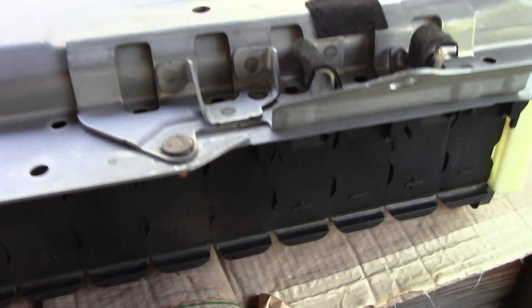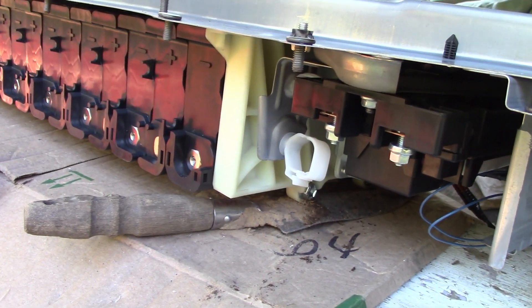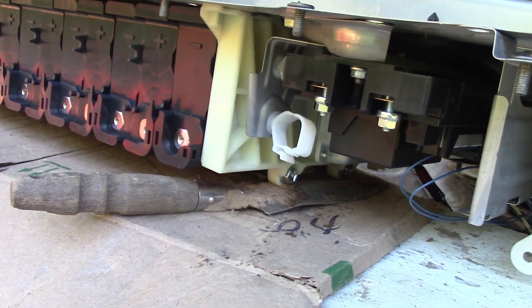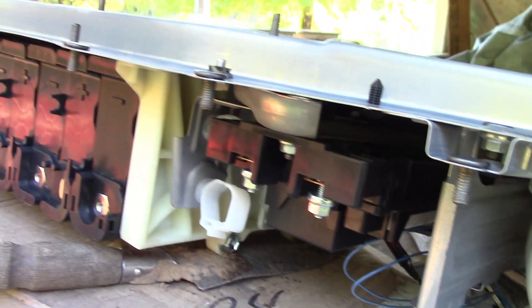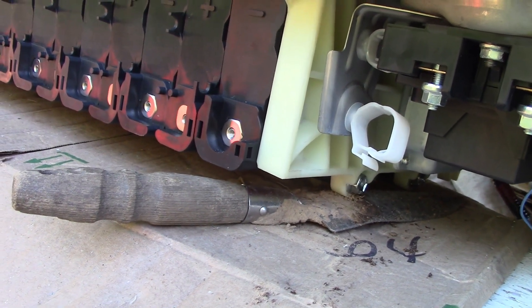I've now got the underside of the battery casing on top of the new cells, and next is fitting the bag of nuts — everything seems lined up okay. Something to be aware of: the screws won't go in fully if you don't lift up the computer end, because the fan end is too long and won't allow the top part to fit on properly. Basically, just shim it up a little bit.